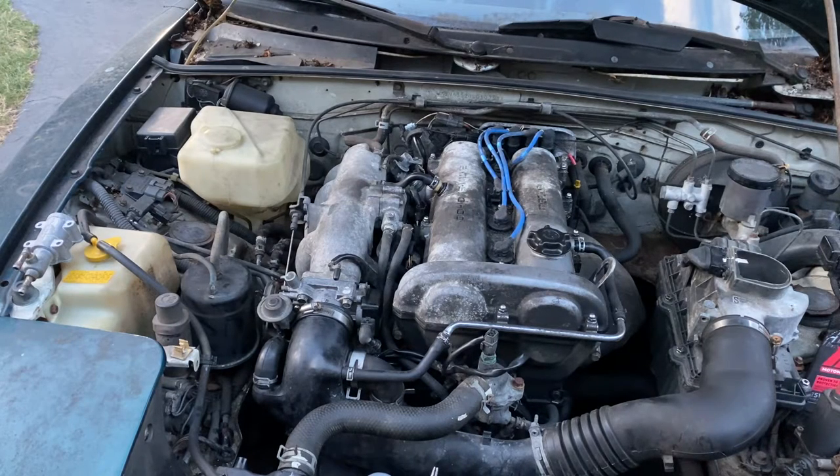Welcome to part three of this crazy 1990 Miata with the idle going up and down and constantly high revving. So far we swapped in a throttle position sensor, which made no difference. We unplugged the idle air control valve and things went relatively normal after that. So we swapped in a different used throttle body with a different throttle position sensor and idle air control valve, plugged everything back in, and the problem is still there. I was pretty much expecting that would solve it.